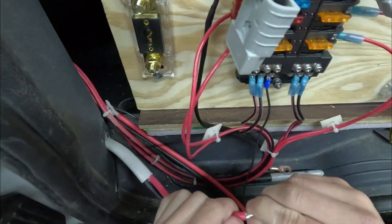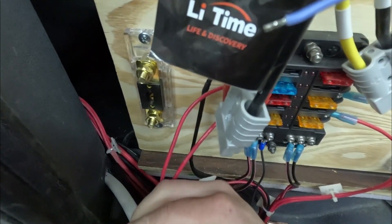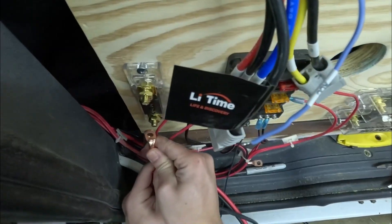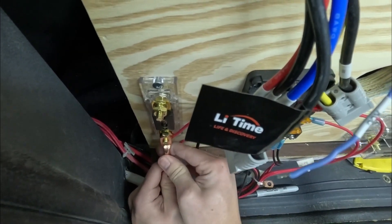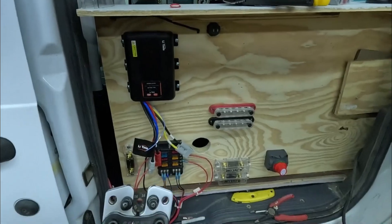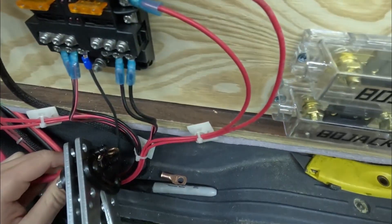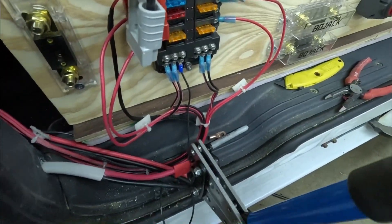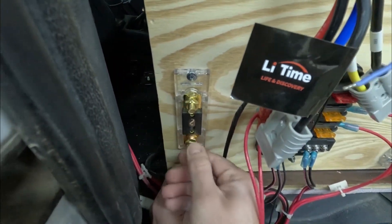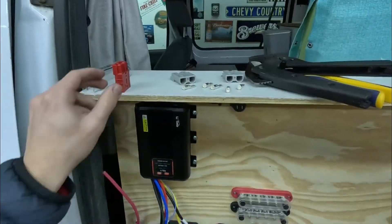We have a very nicely stripped cable. Make sure all the strands are nice and straight, then we're going to grab our heat shrink — it'll go just like this. Grab our crimping tool and line it up in the crimper. That is crimped on there — a really nice crimp actually. Then when we're done we'll go back and heat shrink all of that.